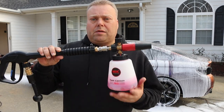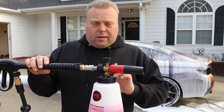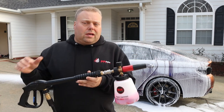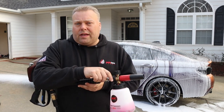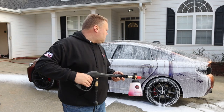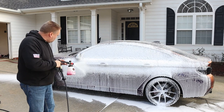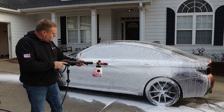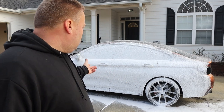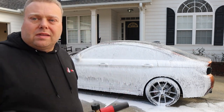As you can see, it's pretty decent foam — it's not full-on foam. So this is the MJJC gun with G-Wash in it as well. This is an auto-metered cannon, so I just have full detergent soap in here; there's a siphon on the tube that keeps it from getting too much, just the right amount. This foam is better than just about any foam cannon out there. I just did an amperage on it — 12.7 on this; it was 13.1 on the other one, so I think that other one has a 1.1 orifice and this has a 1.25. You can definitely see the difference in thickness on the MJJC — much thicker, it's sticking a lot better. There's nothing out there that can beat this gun when it comes to foam.